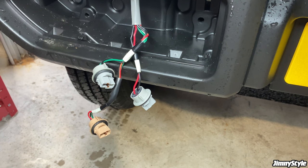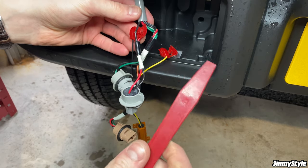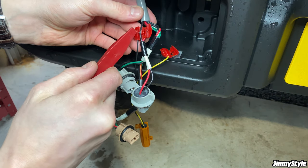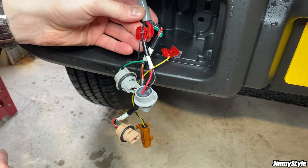So in true Jimny style fashion, as soon as we started filming this tutorial for you, it started chucking it down outside. So we've come into the warehouse now just to finish it off. If you have something plastic and quite blunt, like a trim removal tool, I would advise using this to push down the wire to make sure it properly clamps onto the metal piece inside this lock and to ensure that it makes a good electrical connection.